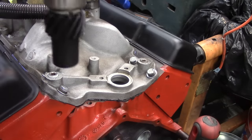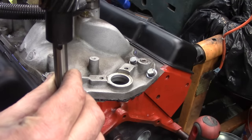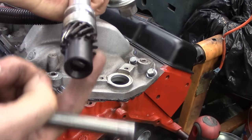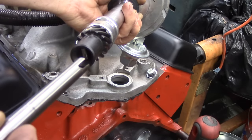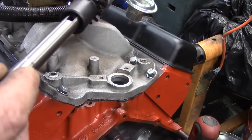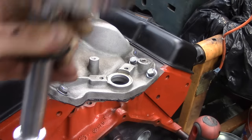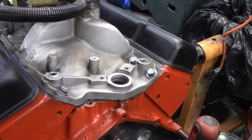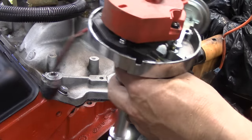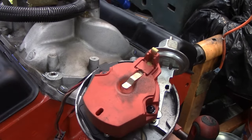What we need to do is get this into the cam gear. But sometimes when you put this down in the cam gear, this thing doesn't mesh right away. You can actually engage the cam gear but have it like this and it doesn't actually fall all the way down. There's a real simple way to handle that. We have our engine on top dead center, we know that. The distributor basically goes in in this orientation — my vacuum advance is going to point toward the passenger side.